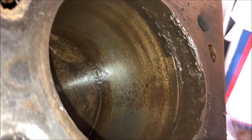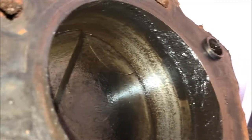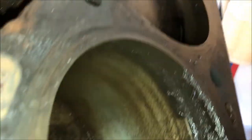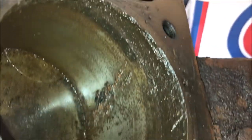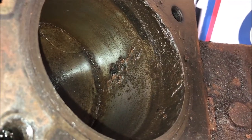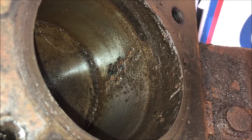This one we've cleaned up massively, but I still think this rust buildup is going to be a problem. The other ones clean up nicely. This side was a little harder to get to - especially back there. Actually cleaning up quite nicely. We might just have to take a hone to most of these to redo the cross-hatching. This one we might still end up taking to a machine shop, but only time will tell.